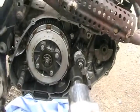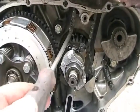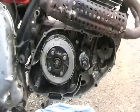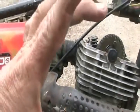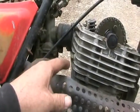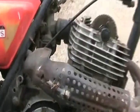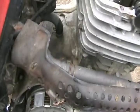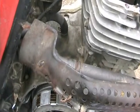The timing chain should now be very tight with no slack. Once your motor's all done and you've driven it for about a week, stop the motor, loosen both those nuts again, let the tensioner re-shrink and tighten the chain again. Two or three times a year, loosen those two nuts and let the tensioner do its thing — that's how it pre-sets itself. More modern bikes might just have one bolt or one round thing on the side of the motor and may never need manual adjustment, though if it has a nut sticking out, you may need to loosen and adjust it.